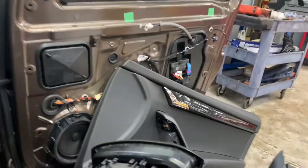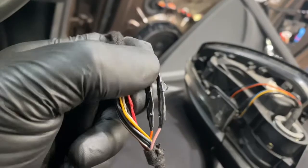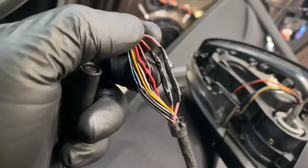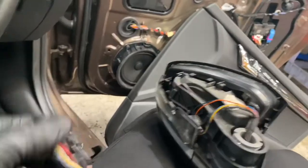The fuses are working and the switch is working, but I've removed the door card — as you can see, it's sitting on the floor. I've investigated the wiring to the motor itself. As you can see, these two wires I've soldered back together and put insulation tape on so they don't short out. It was broken, and this was the cause why the mirror wasn't opening and closing.